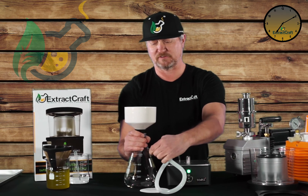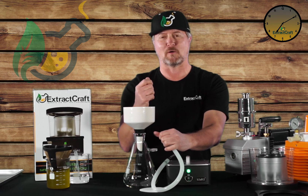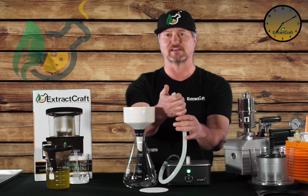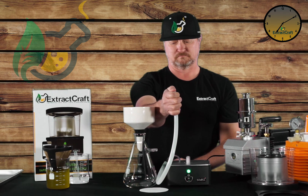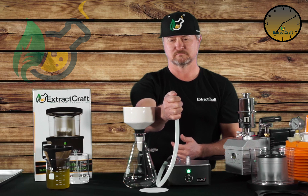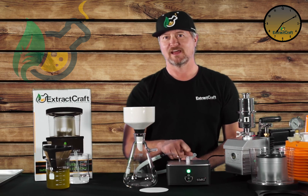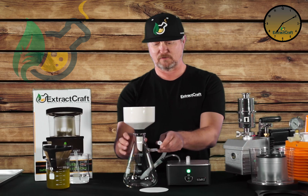Let me show you one thing. Some people are sometimes wondering why the vacuum pump shuts off during the process. If the funnel gets clogged with a lot of small particles, the base here will come under basically full vacuum that this machine is programmed for. So I'm going to turn it on and simulate full vacuum just by plugging this hole, and you'll hear the machine kick on and off when I either release or apply my thumb. So that simulates full vacuum. One word of caution: if it does kick off for any amount of time, this heat post will begin to heat up and you've got to be careful with that, because if somebody touches it they could get burned, or you can melt tubes that are in contact.